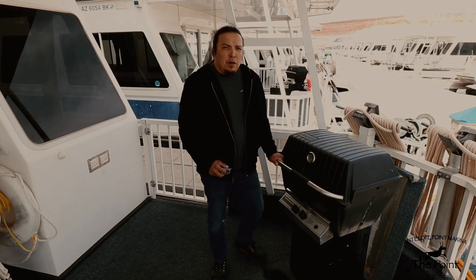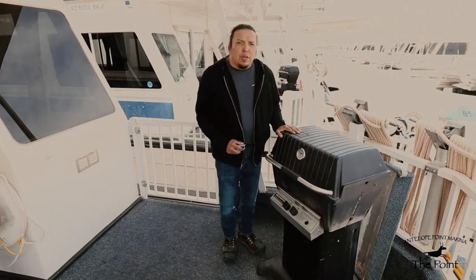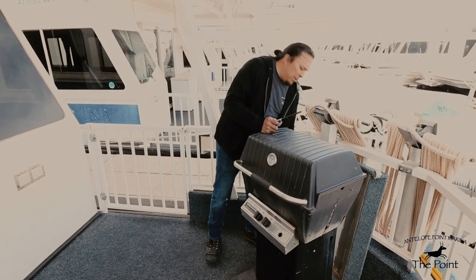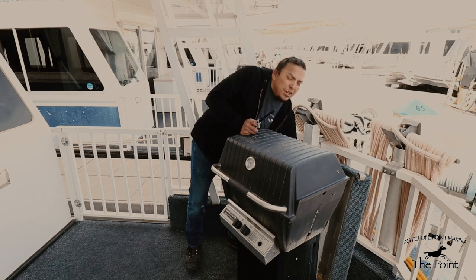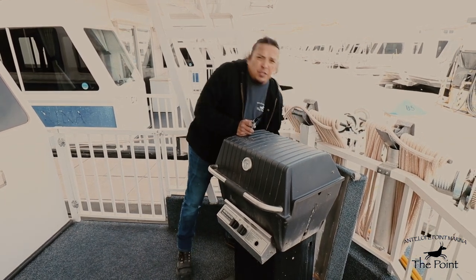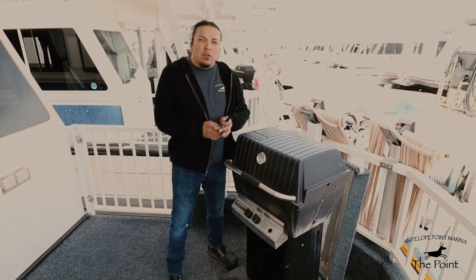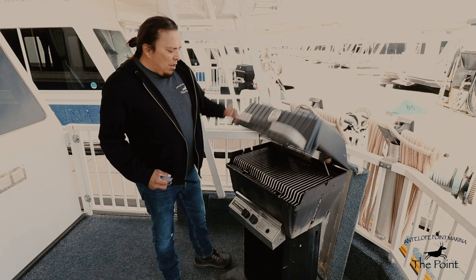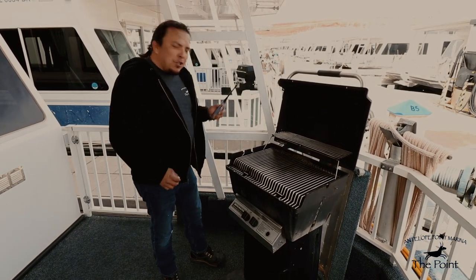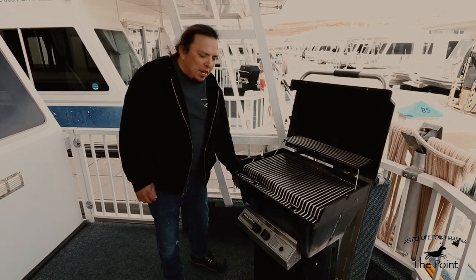With our gas-powered propane grill, we equip you with a five-gallon propane bottle located on the back side of the grill. In order to operate the grill, you need to first turn the bottle to the on position — the valve on top needs to be rotated in a counterclockwise direction. We equip you with a lighter, and with the lighter you're going to light it first, then put it into the access hole on the side.